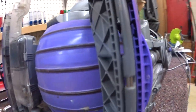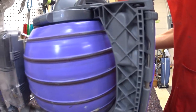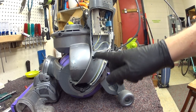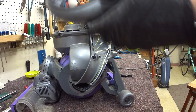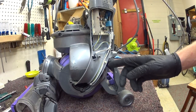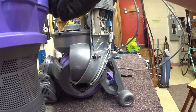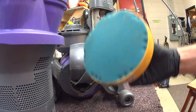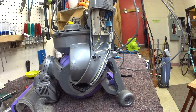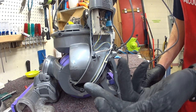You have wires and circuit boards in the ductwork of this vacuum — just to give you an idea how crazy the Dyson engineers were when they were making this. This was so not ready for prime time. Just to show you where that is on the machine: you have this duct cover, and you can see it's filthy. This is not the intake of the vacuum — this is the intake to the motor. So everything in there does pass through this filter, but that filter is only good for two to five microns in size. So you really did have a lot of dust just moving through here.